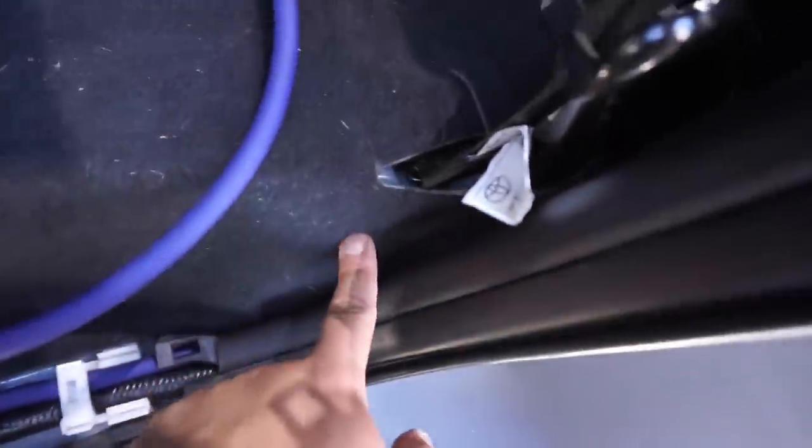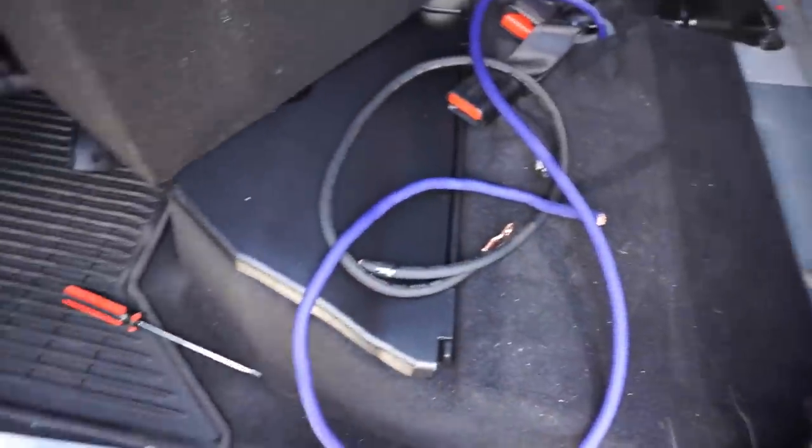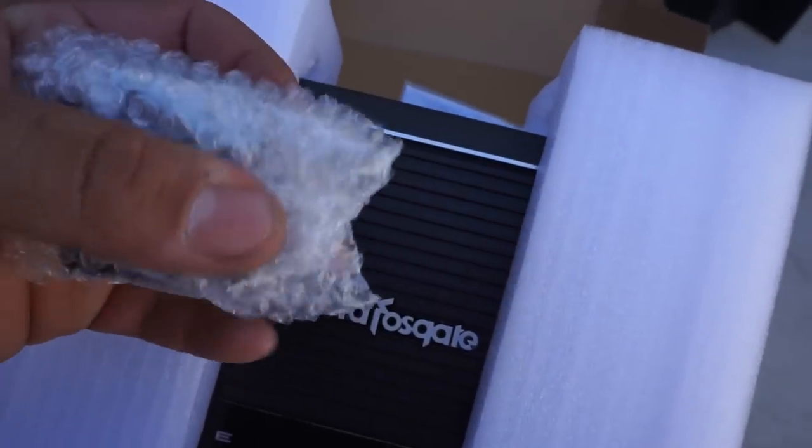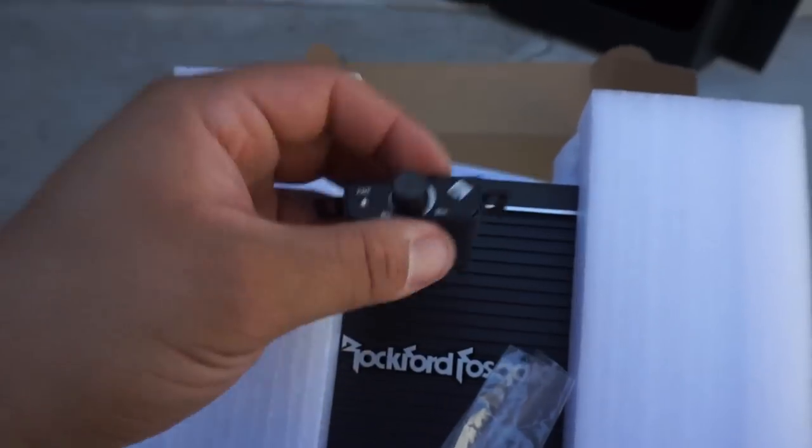I got my wire tucked and ran nicely along the OEM wire harness already in place, with our four-gauge power wire in the clips running underneath this carpet. One thing I had to do was remove the seat belt bolt down here just to pop up that trim piece and fit the wire underneath. I also have to run the bass booster wire for the amplifier — our specific amp comes with a little bass knob which gives you adjustability to control the gain on the fly. It would have been a lot easier to run this wire first, before the power wire, so if you're doing this at home, run it first.